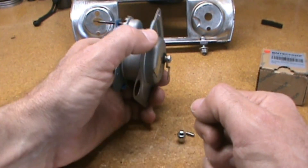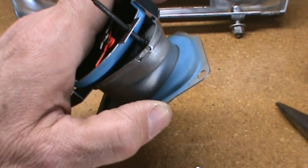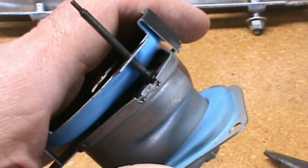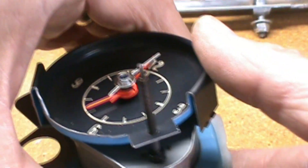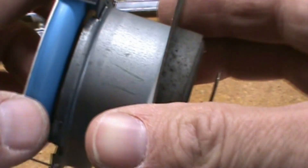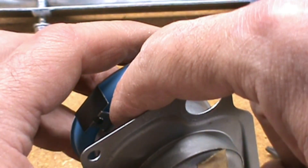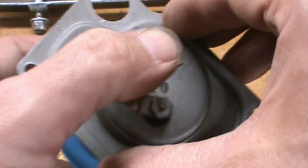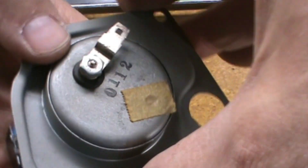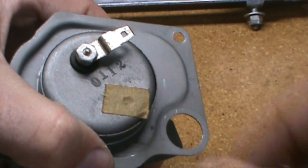But turn it over. There are two tabs that need to be pulled back. One is in the lower right hand corner - you can see it right here. So you bend it back, and then one is on the top side, in between the black tabs here. There's another one here that you need to pull back. Then finally, remove the tab at the back - the electrical connection, the power connection - and just remove that.